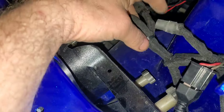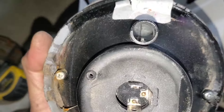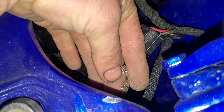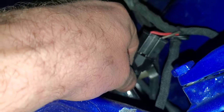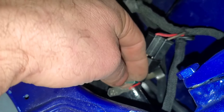I've added one of these so I've got two of them. These are my halo rings — on these housings the halo rings plug in one on each side and it lit up the surround whatever color you wanted. These here have two — looks like a female blade — so I'm going to have to get a male blade. One of these you can hook up to your blinker and one to your parking light. The blinker will make it light up amber, and the other wire will be white. I got these on sale on eBay.